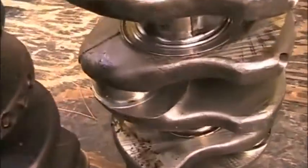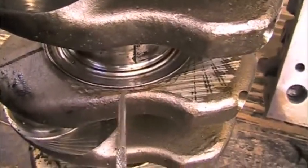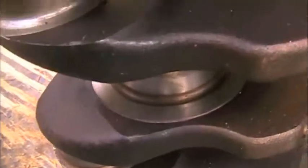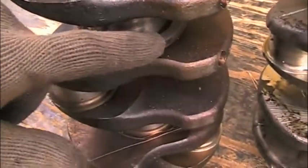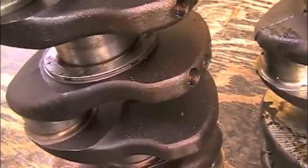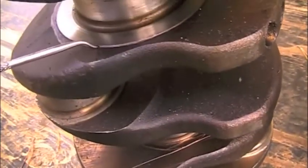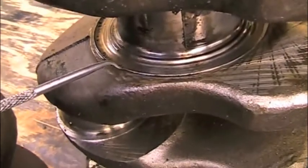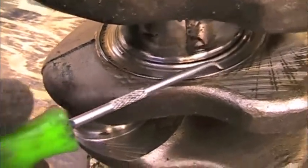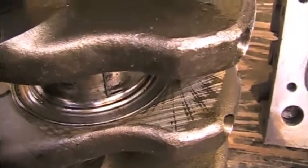It does the same thing with the crankshaft. This is where that thrust washer was sitting, or used to sit. You see how it's supposed to be — you're supposed to have a nice smooth surface for the thrust washer to run against. The thrust washer sits right there, and this is what locates the crankshaft in the block. You can see this is actually built up a little bit — there's a little bit of a ridge right here — and this one right here you can see is the original lip. But this thing has a huge cavern in it; it's been running without a thrust washer for quite a while.